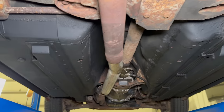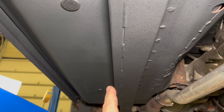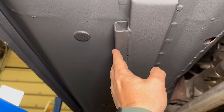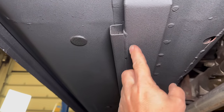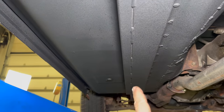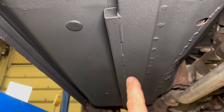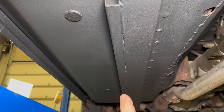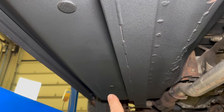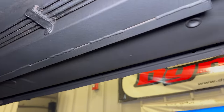I just wanted to show you underneath the car real quick, because one nice thing to do on cars that are going to be race cars and you're going to be changing the wheels all the time, is to weld a nice bar here. This is added to the original frame section, giving you a good sturdy jacking point pretty much the entire length of the floor pan, so you can jack the car up at any of these spots to change your wheels. I can stick it here in the center, jack this entire side up at once, and replace both wheels and tires on this side of the car. As you can see, the floors came out pretty good.